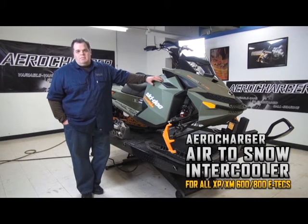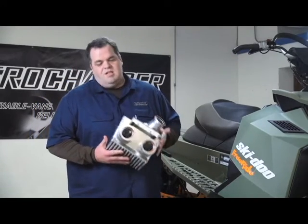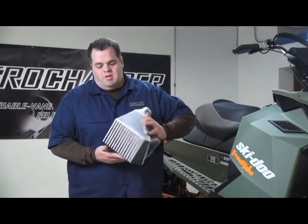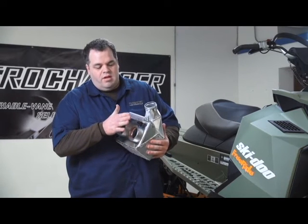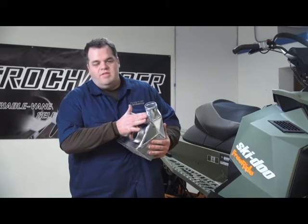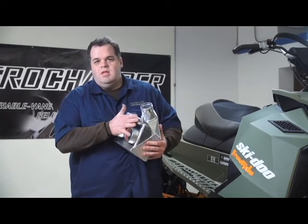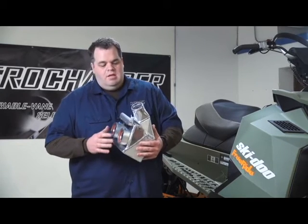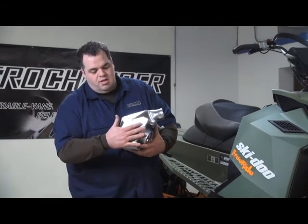He's getting the exact same intercooler setup and system that's available to the consumers. This is the air box — it's a neat piece. We worked really hard on this and it's turning out to be very effective. Basically throttle bodies go into here. We've got our additional injectors here, fuel rail — all this will basically come installed. If it's an upgrade you can pull your components off of your old system; they bolt right onto here. Air inlet is a two-and-a-half-inch inlet. The air gets distributed here, comes down, goes through our core into the intake.